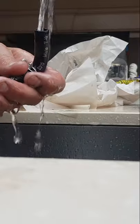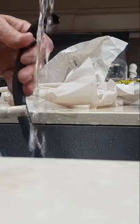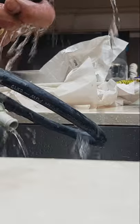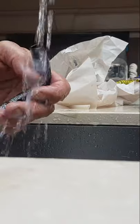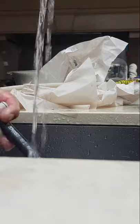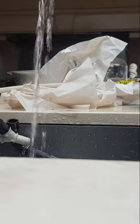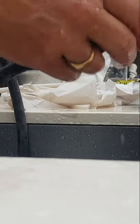One thing I would say is I tried to use a screwdriver to put the overflow clip back on. What I should have done was get a pair of long nose pliers and just squeeze the two ends in, then push it back on. There's the black seal that goes inside that little one-way valve. Don't forget you need to put the ball back in there, otherwise there's a risk that water could backfill into the machine, which would cause you some problems — if not just dirty washing at the very least.